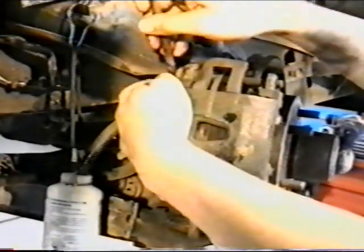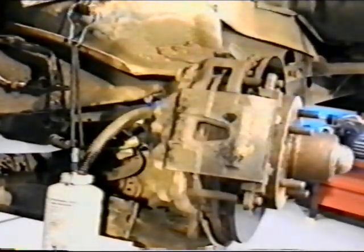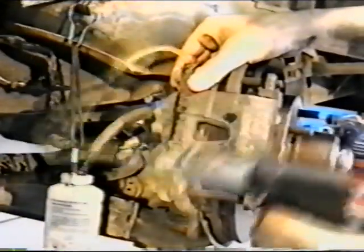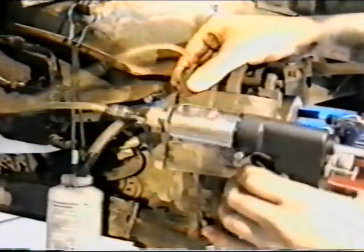Now, with the injector set up for RFI bleeding, open the bleeder screw and connect the tool's output end to it. Caution! Safety glasses should be worn during this procedure. Aggressively inject fluid using 6 to 8 strokes. A swirl pattern is created, which lifts debris and sludge out of the cylinder. Close the bleeder screw and reattach the brake hose.